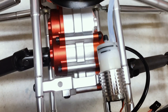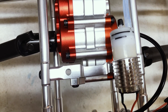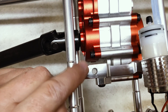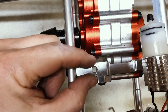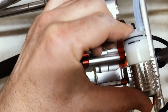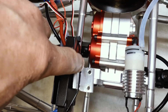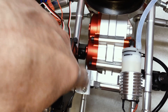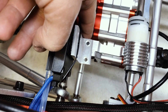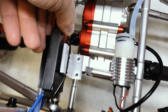Then you're going to mount your water pump to this cross brace. In the kit there's an included screw — 2.5 millimeter hex — that just screws in using the hole on the bottom of this side. It's a little hard to get at, but if you have a ball-head 2.5 millimeter hex driver you can fit it in there without removing anything — just tighten that one screw up and it's on there nice and tight. Then you're going to do the same thing with your ESC. The ESC already comes mounted to a plate with two holes, but you're only going to utilize one of them — the opposite hole from where you just mounted the pump. There's already a screw in the kit; just screw it right in and tighten it up. It's already threaded and holds on real nice.